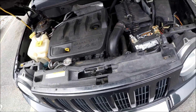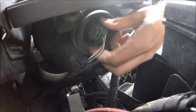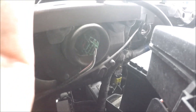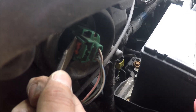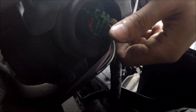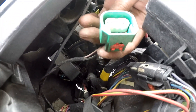Alright, so I'll show you on the driver's side first. Here we have — hope you guys can see it clearly — we have a connector here. So what we do first, there is this red pin. I'm gonna grab a screwdriver — it doesn't necessarily have to be a screwdriver, but a screwdriver will work best. We have to pull on this little red pin to pull it out. Once it's out, we are able to press this lever — this plastic piece — and it helps us to disconnect the connector from the bulb.